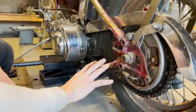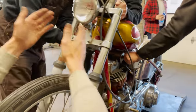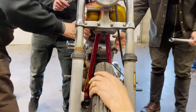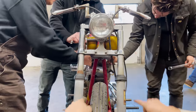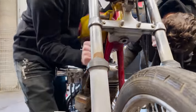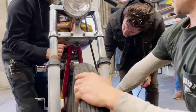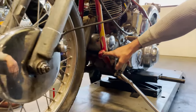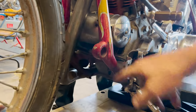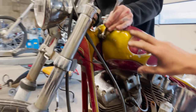But everything's still intact here. All the axle plates are in incredible shape. Same thing here, spinning all the way through. These frames are always straight leg. They've never been wishbone like an early Panhead frame would be. Early Panhead frames split like this, kind of like S-bends down, whereas all knucklehead frames are straight V, but so are later Panhead rigid frames, so it gets a little confusing. Still, the sidecar loops are intact. And another way you can tell it's an early frame is the rake.